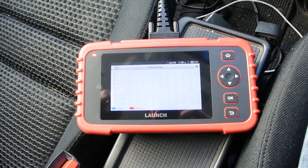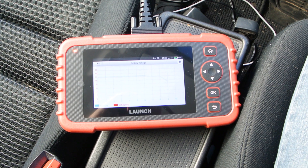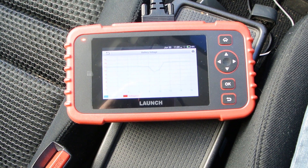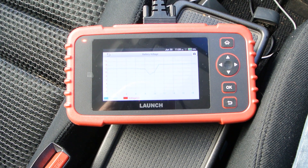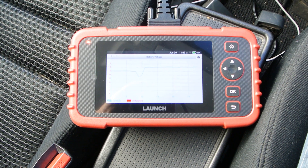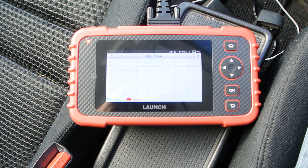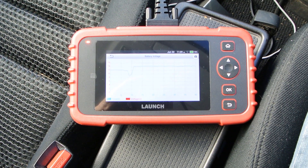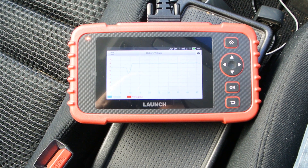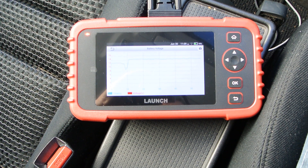Battery voltage is quite interesting too. You can put it in, turn the key on, and crank the engine to see what happens. A very good feature is the built-in battery, because that also means when you crank the engine the scan tool doesn't die. I have quite a few at work that as soon as you crank the engine the scan tool dies because the battery voltage drops too low. It's not exactly an oscilloscope, but it showed the battery dropped to about 9 volts on the initial crank, which is acceptable.